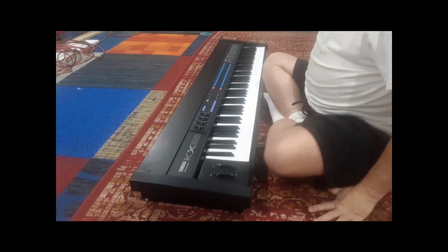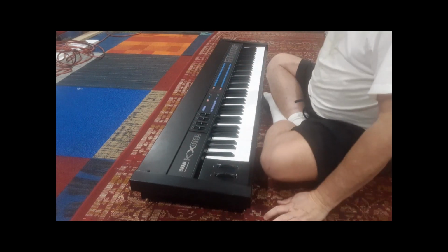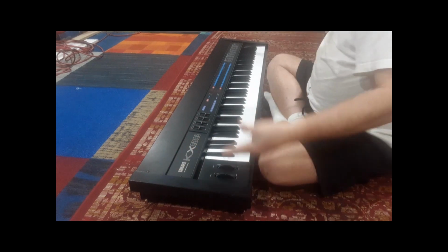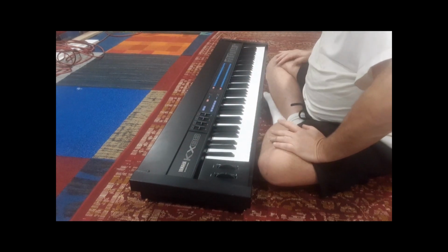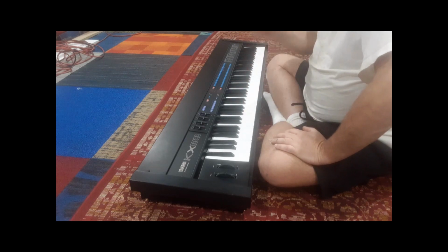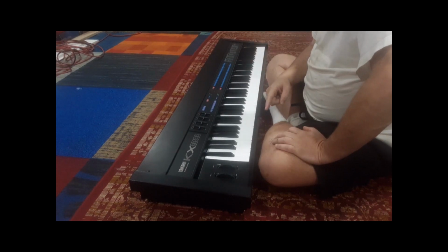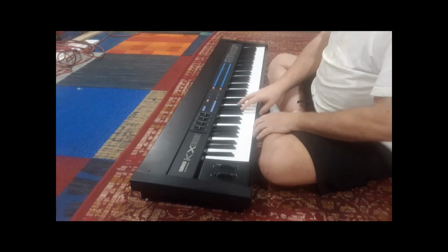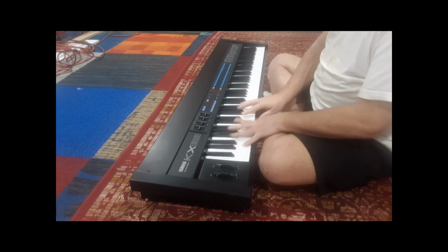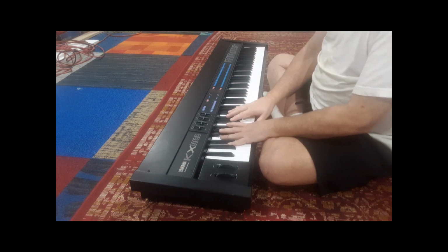Now you're ready to remove the 4 top screws. Okay, now when I remove these 4 top screws, the whole panel is going to lift up, and you pretty much got access. But in this video, since we're going to be taking out the keyboard to service the keys, yes, on a DX7 you don't need to remove the keyboard. The keys slide out. But on the KX, the front rail here doesn't give you enough room to slide the keys out.